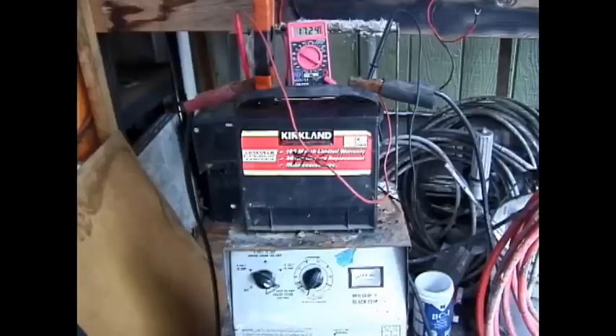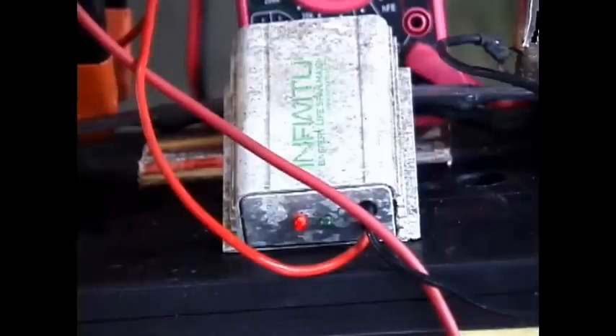Two: the battery can have chemical additives like the old VX6 or the modern Charge It or Battery Equalizer, which are products containing aluminum sulfate or cadmium sulfate to cause the sulfation to be removed. I've used alum, or aluminum sulfate.